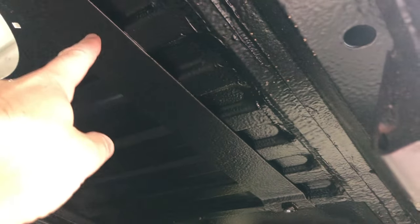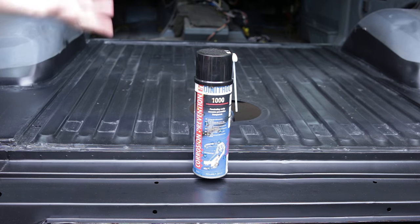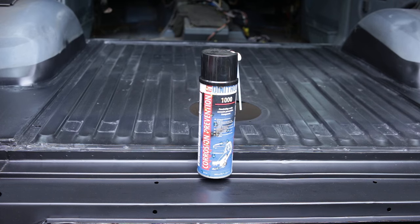So I'm going to get the cavity wax up into every single individual little cavity. I'll be using Dinitrol — I have it left over from the other chassis. I think this is pretty much a full can, might not be enough. But I'll do the hard to reach places first, and I can always do the rear cross member later. I've also got the squirty out everywhere hose.